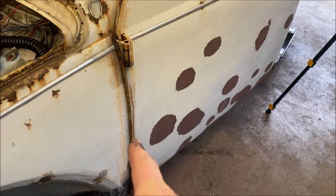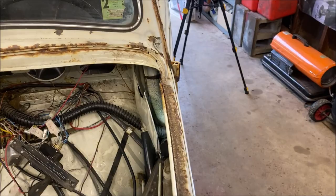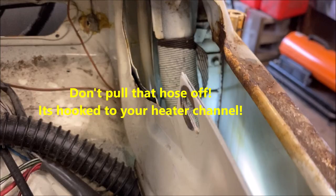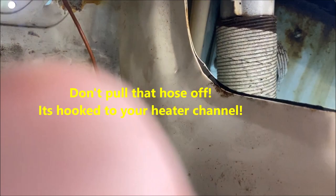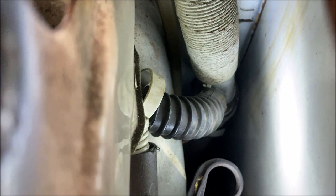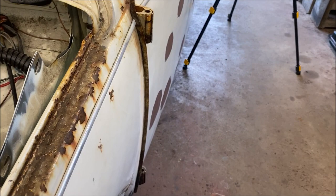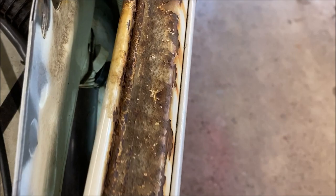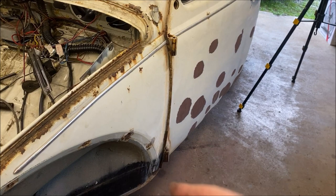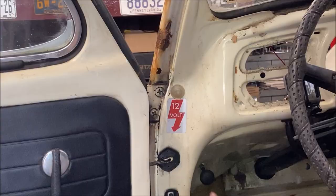There are your hinges. Go inside and look about where the hinge is — look up in there. Two screws, see them right there? On the inside there's another one. It's hard with the camera but you get the point. Spray PB Blaster in there, or whatever you like using. Down inside is the lower hinge. Look to that side of the hinge, down inside. Once you find the screws, just shoot your PB Blaster down inside there — get it all on the back of the threads of the screws coming through. You should do that. I don't see anybody doing it and I don't know why.